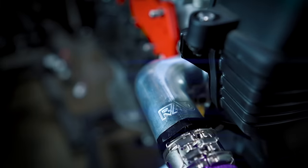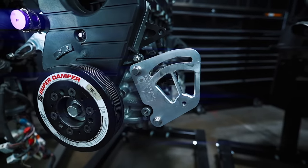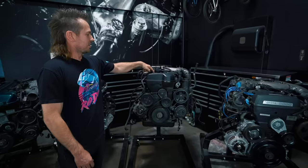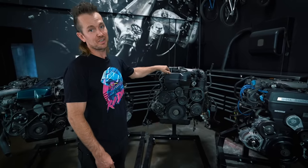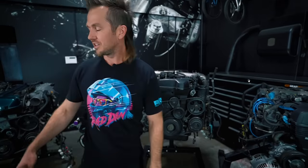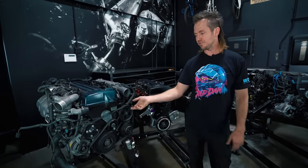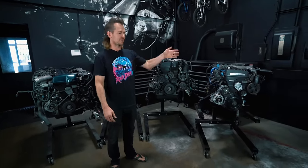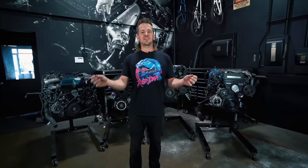If you guys look close, this has a couple of our Rad Industries billet parts that we sell on our website. We're definitely into 2JZs over here and we're going to start making some parts for these non-turbo motors — mostly the VVTi one, because it has VVTi which is going to help spool. Cool thing about these ones is the head is really good, almost like you get a mild port job and you have VVTi, and these are pretty cheap to get as of now. As we all know, these things have skyrocketed in price and they're almost not worth paying what they're asking — they want six grand and you still have to refresh stuff. So I'm trying to come up with solutions to help you guys get into a 2JZ cheap, like they used to be. That was a quick run through on the 2JZ GTE versus the 2JZ GE and the small differences — hopefully that answered your questions. Thanks for watching.